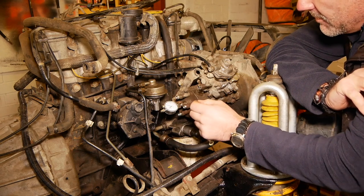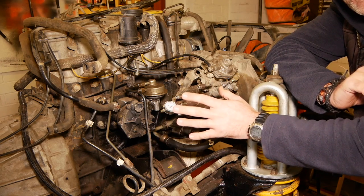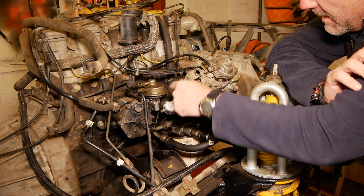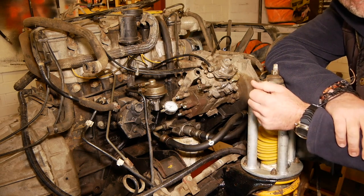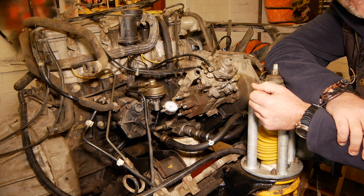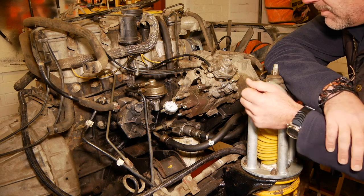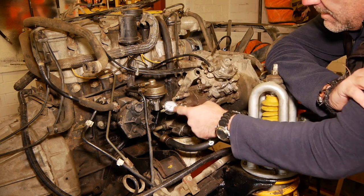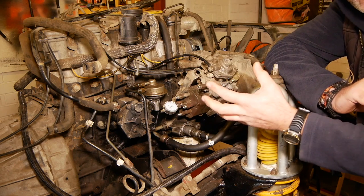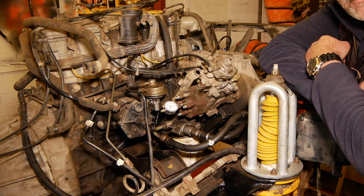But as the pump rotates, you're getting about a millimetre movement back and forth, am I right? A couple of mil of movement in the piston, and basically this gauge is measuring it. It's probably actually more than that in the actual pistons, but for us, yeah. We're after a setting of 1.54. So basically we're looking to take this from zero as Paul rotates the pump to get to 1.54 and then lock it off there, and that's the position we're looking for. It's not the top of the stroke, but it's where we want it to be set for the timing.